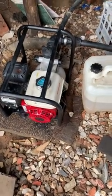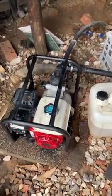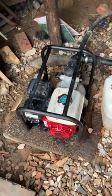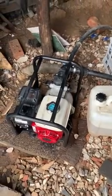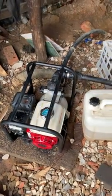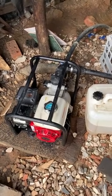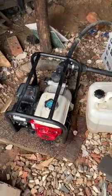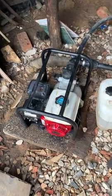Check the air filter as well, make sure that's unclogged, but we never had a problem there — it's not really dusty here. It was back and forth to the dealer many many times, restarting problems for weeks. One thing: it did steadily get a bit worse. Before this it was running for half an hour and then cutting out. The dealer couldn't find the fault because when it's not under load it doesn't have the problem, whereas we were running it pumping uphill 30 meters, nearly flat out, and it would cut out every time.